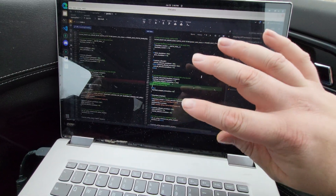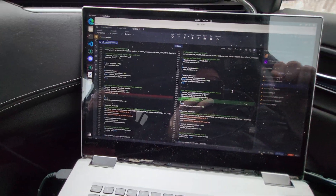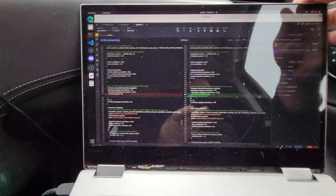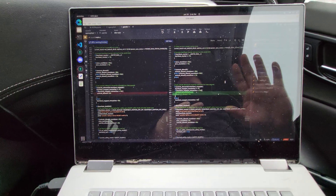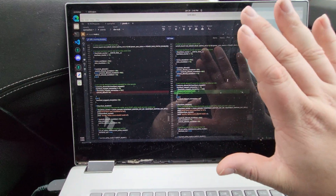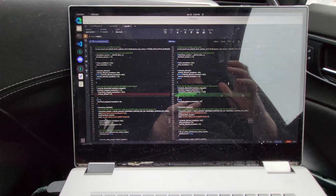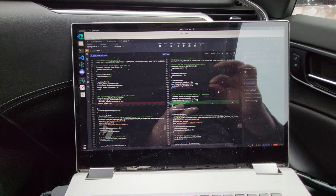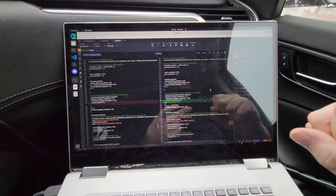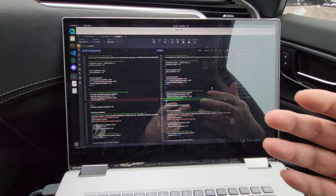On the Panda, I've disabled all of the places where it turns off controls — all but one of them. Only the brake is still enabled. On the OpenPilot side, I believe I've got all the workarounds gone. Right now the Panda is the only thing that needs work — we have to figure out why it's sort of crashing. I also turned off all of the safety limit enforcement for the steering torque, and it's amazing how much happier it is.